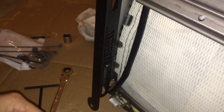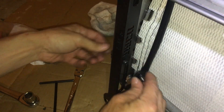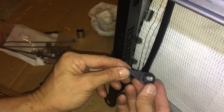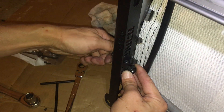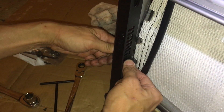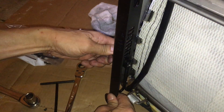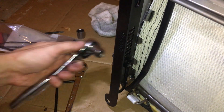On this side you use the bolt that comes with the Paco Sport rail — this little ball-end bolt — because once you put this on and get the seat into the car, you can't reach the bolt. That's why it has this little feature: when you tighten it down, the bolt spins until it hits the rail, stops spinning, and then you can tighten it down. It prevents the bolt from spinning freely, so you can tighten this side without holding the bolt. This is only on the seat buckle side. That's a 14 millimeter.